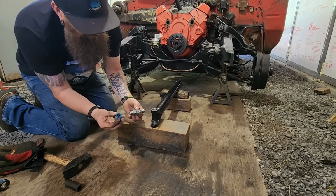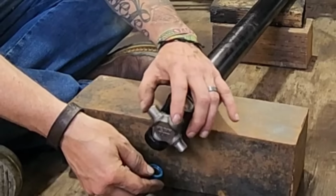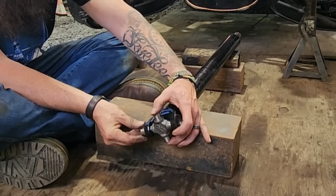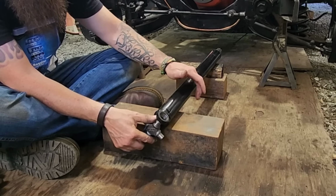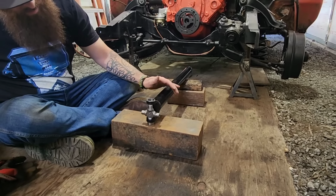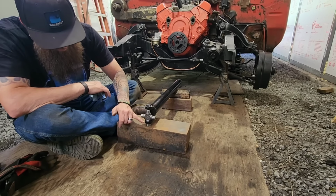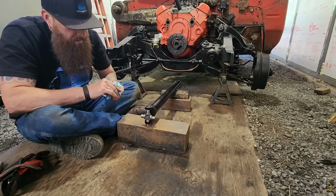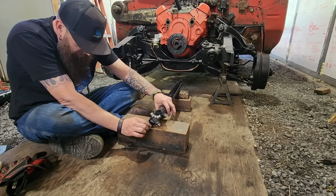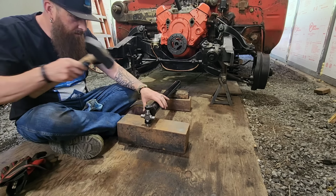Now we'll take one of them, get this in here, and then insert the cap from the outside. Engaging those needle bearings. And I'll try this method, and then be able to smack on the drive shaft itself, pressing it down over that cap. Hopefully keep everything centered up and even as possible. We don't want that to go in crooked. Alright, let's see here.